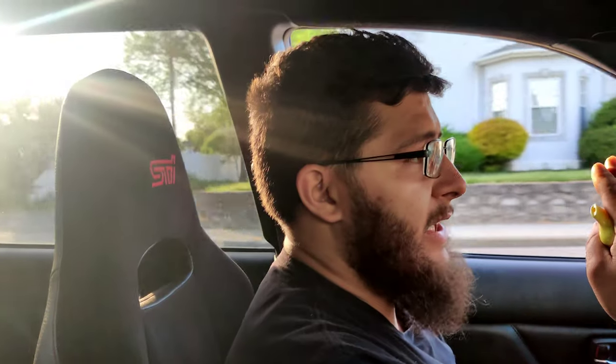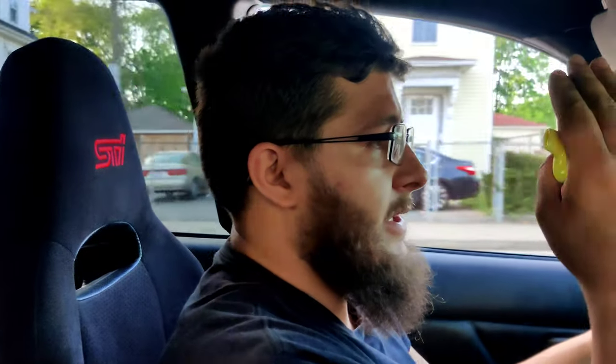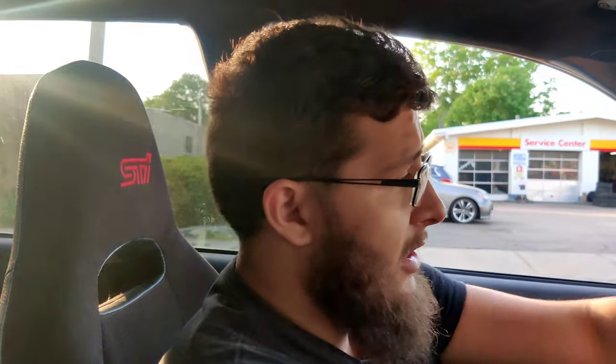And as we are revving his car up to 2,000, 2,500, 3,000, it's going up in the range, which means that we're demanding more fuel, but the car's not delivering more fuel. But we're still adding more air, and that's why he's running lean. And unfortunately, I'm going to deem it an issue with the tune. That's the only thing. We've already set his fuel pressure, especially now that the car is running. We were able to get the fuel pressure right.